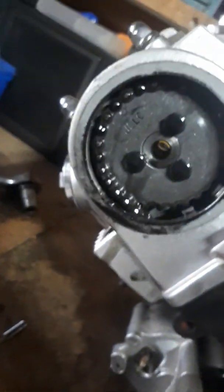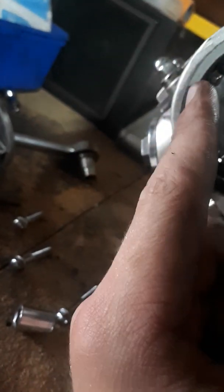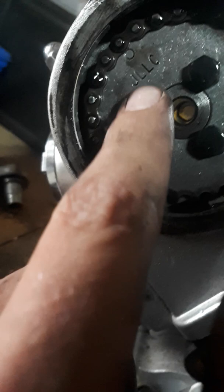Some oil will come out while doing this, because this bit of the engine does get oil. But as you can see, the marking should be like that, directly diagonal on the motor. Usually there's a marking around the piston. I don't know if that's a gasket, yeah. So that's a gasket. There's no mark on this one. But usually there's a mark straight dead center, and that tells you where the motor needs to be, and it's about there, which is perfect timing.